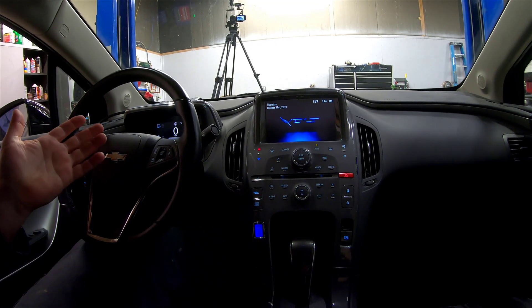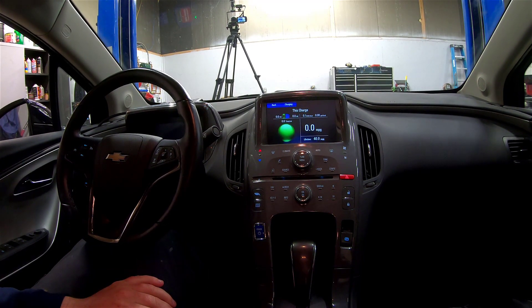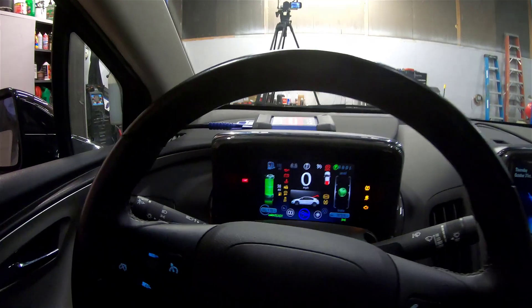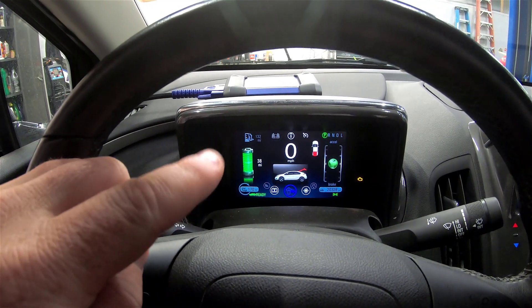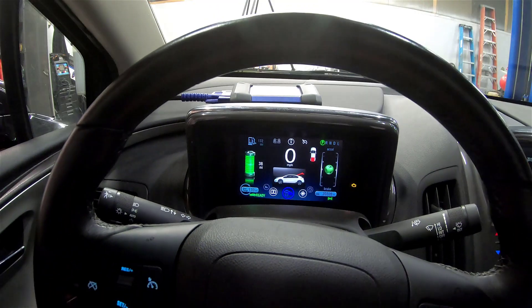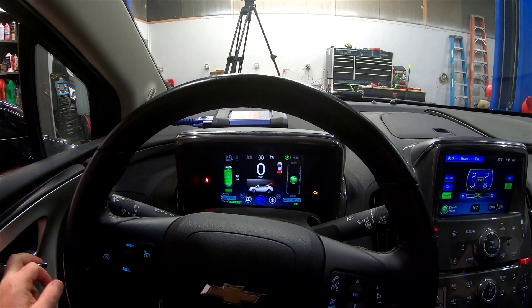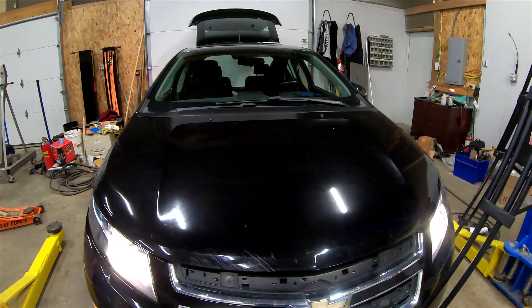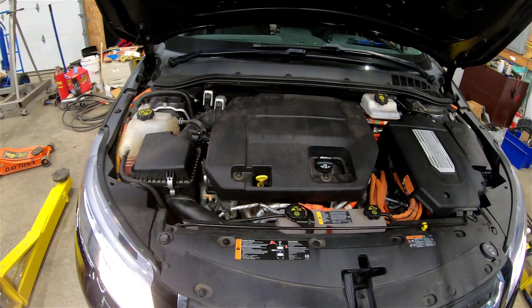This is the dash just from having it in the on position. We're going to go ahead and power off, then push the brake pedal and push the power on. This is new — I have never had the dash completely light up with all the battery information, so this is good. You'll notice you don't really hear the car running, and that is because this is a hybrid electric car. The car doesn't run until the battery runs out. To be able to hear the car run, we have to open the hood. The reason the engine will start when we open the hood is because there's a hood switch — they don't want mechanics to have the hood open and the engine just turn on when they're starting to work on it. So let's see what happens when we open the hood.